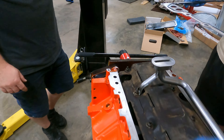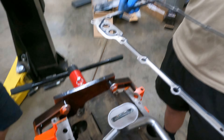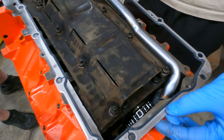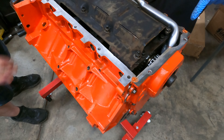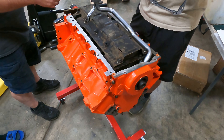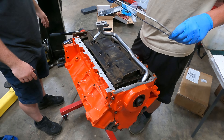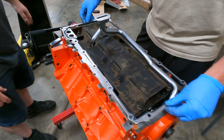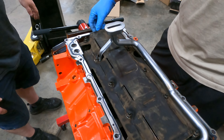All right, so we went ahead and got our Holley lowering oil pan. If you guys got a lowered truck, this is the one they recommend — I'll throw a part number up for you. We got our screen pickup in, got our gasket ready, everything snugged down. Don't forget to dab at your mating surfaces. Going ahead and lining it up right now.